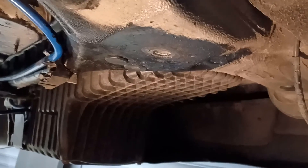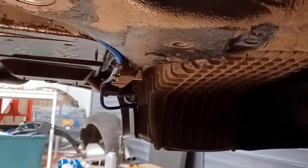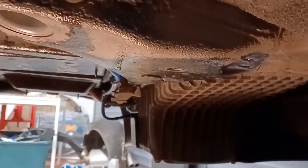Here's the good news — I've actually got the bolt out, I've redone the threads with a tap, put a bolt in, and torqued it up to 110 Newton meters. It holds.